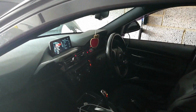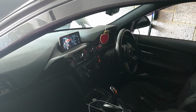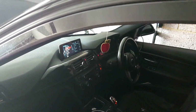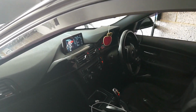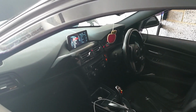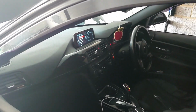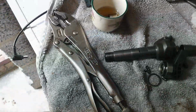But these cars have problems with the chain, everybody knows that. I will check now what's happened with the chain. If the chain is fine, just take that cap out and see if the camshaft spins with the crankshaft at the same time. Another thing will probably be the injectors, the solenoid is dead or rusty. But before I go further, let me see what I can do, and then I'll come back to the video, okay? Stay tuned. Hello guys.